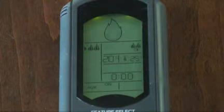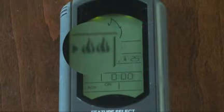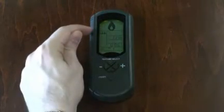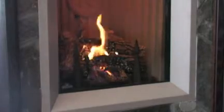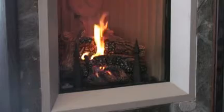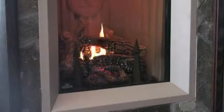To choose one of three preset automatic flame modulation modes, move the cursor to the double flame icon by pressing the down button once. Use the plus or minus button to choose the setting you prefer. Each of the three icons in this frame represent three different cycles that will change the flame height every 15 seconds for a total cycle of two and a half minutes. This mode automatically defaults to thermostatic control, and therefore the transmitter must be calling for heat for the flame to be on.